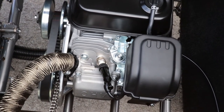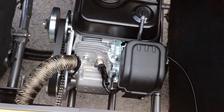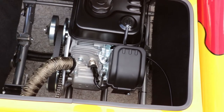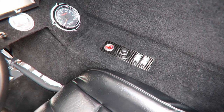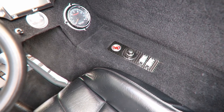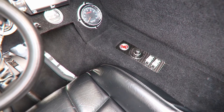After the old motor finally blew a rod about four or five years ago, I kind of lost interest and it sat covered in the shed for years. This year I finally brought it out of storage and put a new motor in it — a Predator 212cc, about six and a half to seven horsepower. The cart originally had a full electrical system with an electric starter, but I eliminated all that because electrics in a go-kart didn't work too well. I went with a basic pull-start so I can just get in and go.